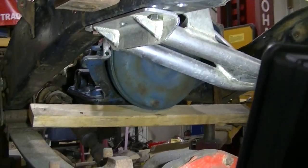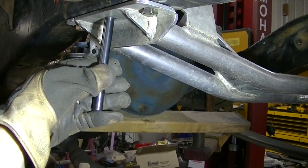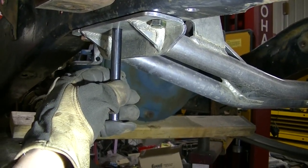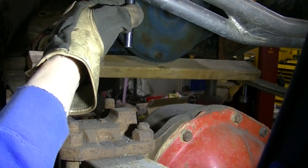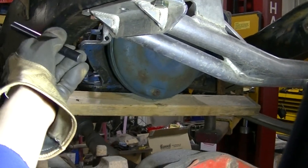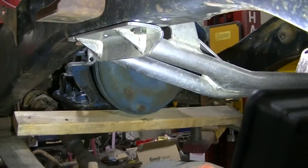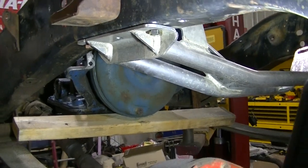I got the truck up in the air so I can do this more comfortably. I'm using a transfer punch to mark the holes — it's a punch with a sharp end that fits in the hole snugly. You hit that and it finds the center of the hole without having to eyeball it. I barely had room to hit it with a hammer — I had to turn the hammer sideways because there's really no room. I've done that with all the holes now. I'll take the crossmember out, find my punch marks, hit them with another center punch to make a nice dimple, and then start drilling.